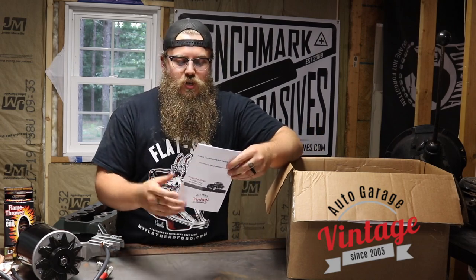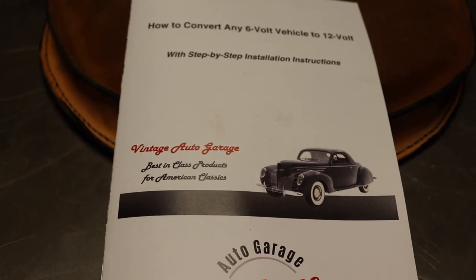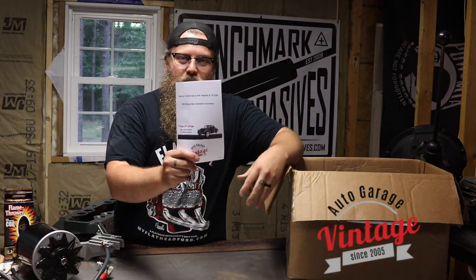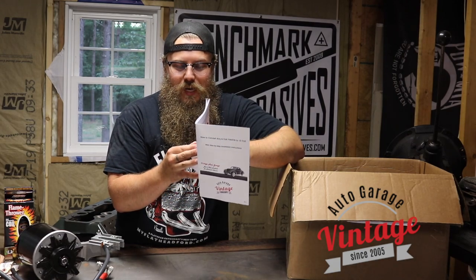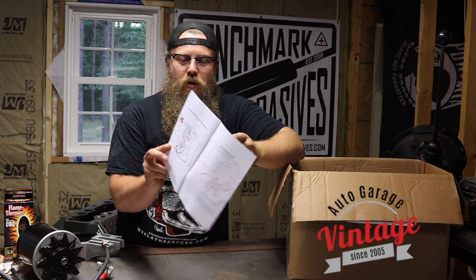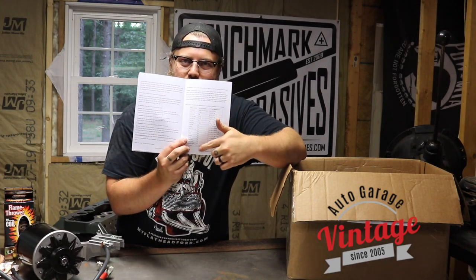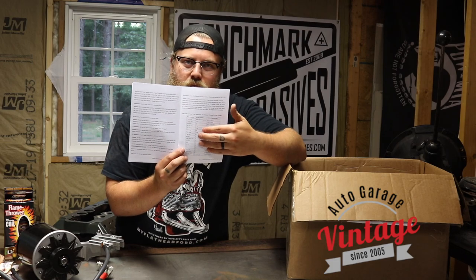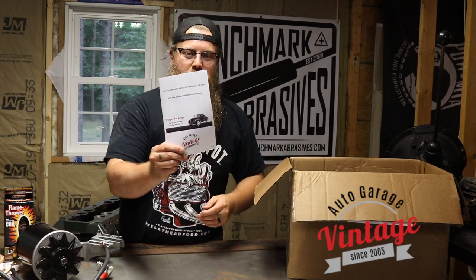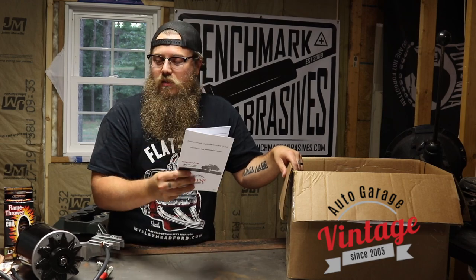Here's something really nice — what is a good kit without good instructions? This is a guide on how to go from 6 volts to 12 volts. In the next video I'm going to show you how we install all this onto a fire truck. This basic guidance manual shows a lot of great information including wiring diagrams in the back — really important — showing how you should wire up your starter, alternator, and ignition. Another really good resource inside this book is a conversion chart: it lists all the different part numbers for 6 volt bulbs and shows you the corresponding 12 volt bulb. So this is what you have, this is what you need now. Make sure you pick up one of these books — you can buy them standalone. Read through it before you get the kit; that will give you a lot of good information before you get started.